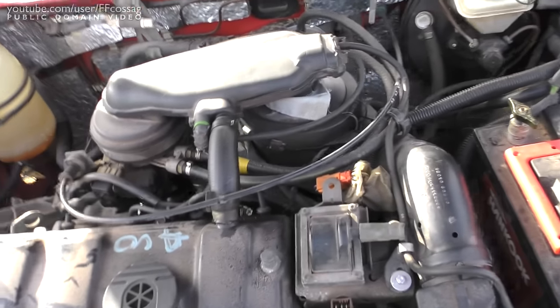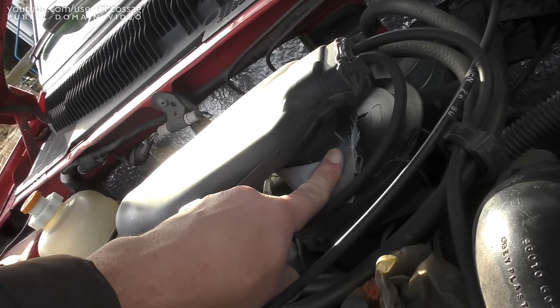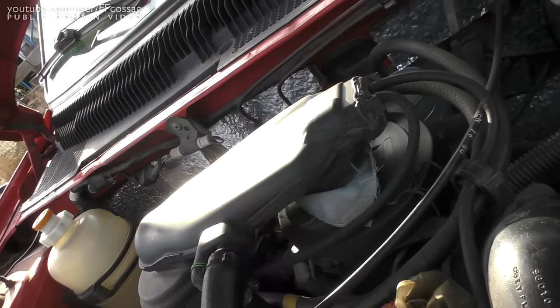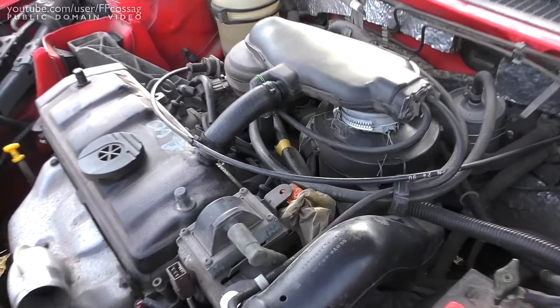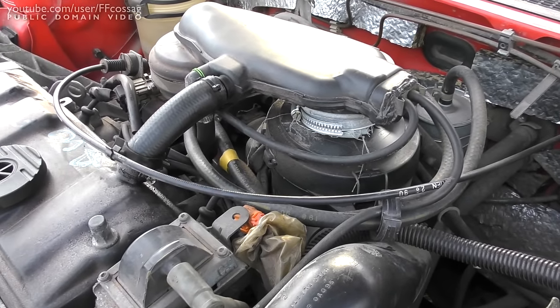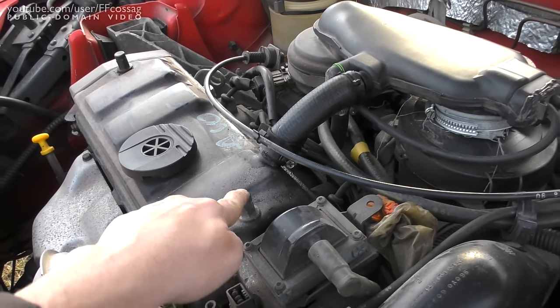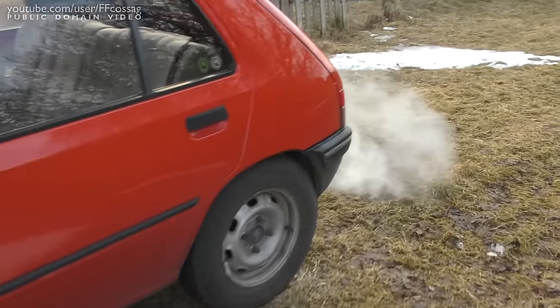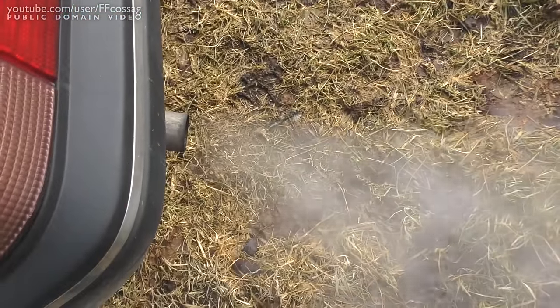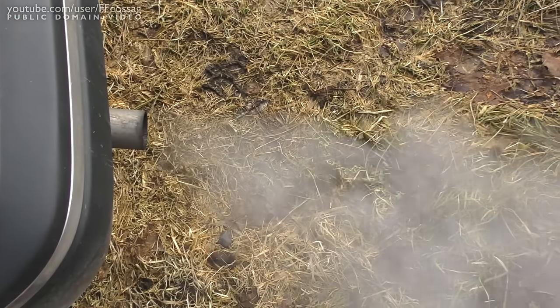That's something. And I did notice this trap is full, which is not good because that's filtered air. Well, I found a replacement trap for that. I've got no idea what happened with the old one, but this is not a happy engine. It's been running for a minute now, and if we look at the exhaust, we've got one cylinder which is just not getting proper spark.